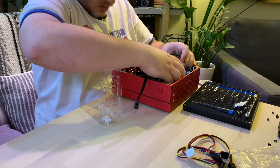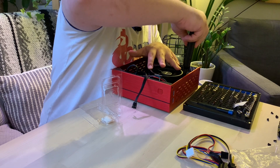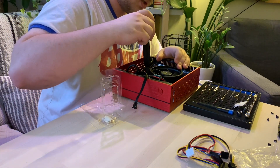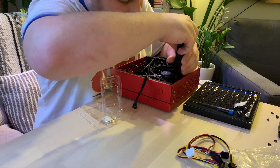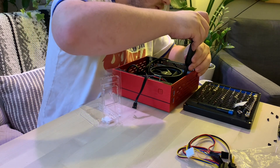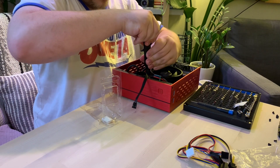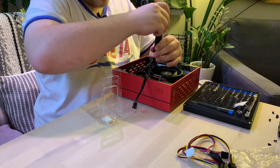The way that you want to tighten these screws is diagonal — so you tighten one over here a little bit, then you do the opposite one, so you're applying even force to the whole thing. You might have to push down a little bit. Don't be too worried if it makes any snapping noises — it's usually just the plastic adjusting. It's going to make some horrifying noises as the springs rub against the thumbscrews. It's my least favorite part of building a PC. There we go — it's all tightened in and it's even.